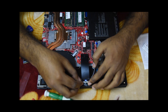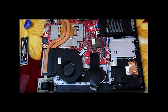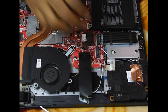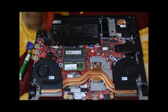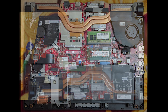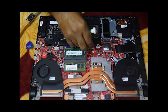I added a rubber band for holding the pad in place and placed it carefully into the slot. This laptop has two empty slots to upgrade, each supporting up to 1TB. After placing the thermal pad between the heatsink and SSD, I tightened them with rubber bands, and now it's time to place it in the slot. Finally, the work is done. Blowing the dust one last time, then reconnecting the battery and RGB cables, and screwing up the back shell of the laptop.